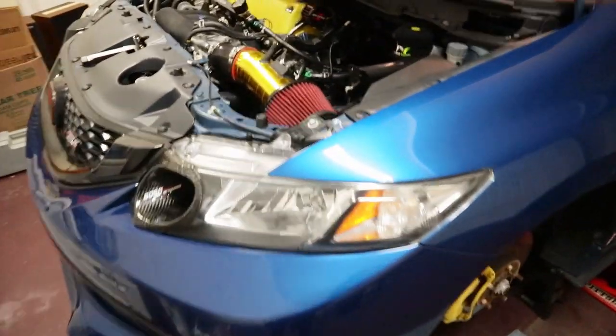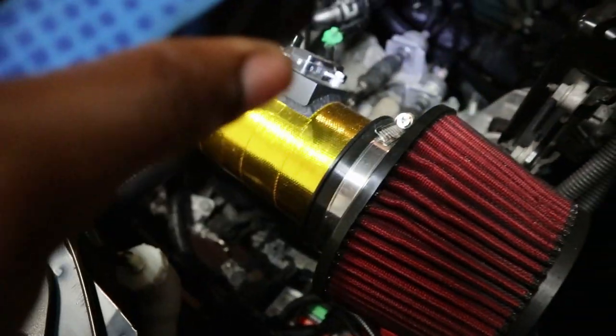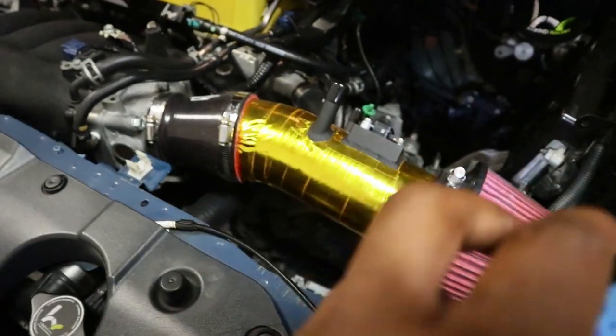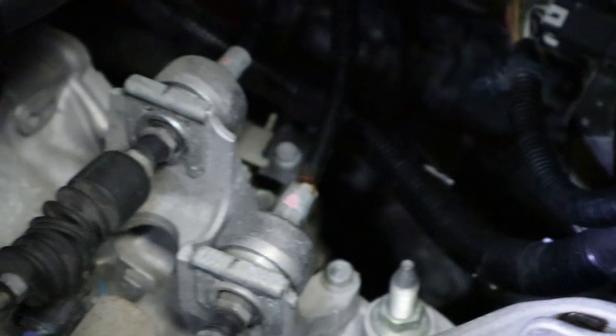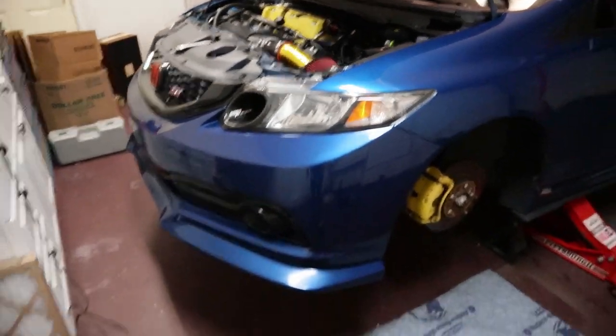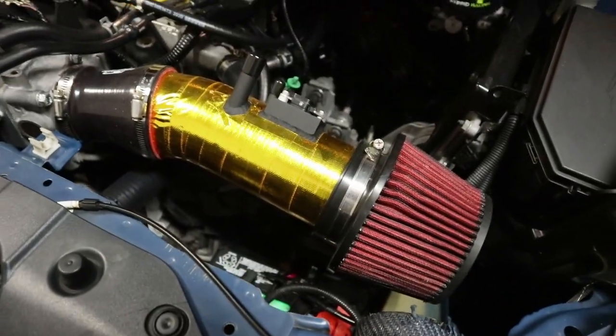The car is up in the air. What you're going to do next is disconnect everything connected to the trans — even your slave cylinder. Disconnect your shifter bushings, shifter cables, all of that. Anything touching or connected to the trans, including the wire harness in the back. Move everything off the trans so when you drop it, it won't be pulling anything or messing anything up — that way it'll be easy to pull out.